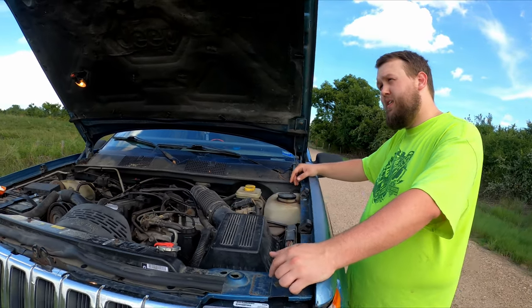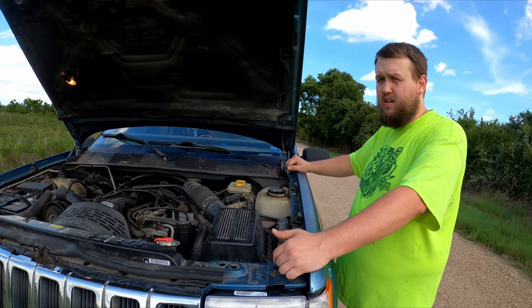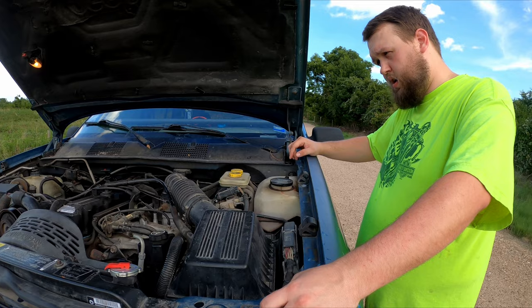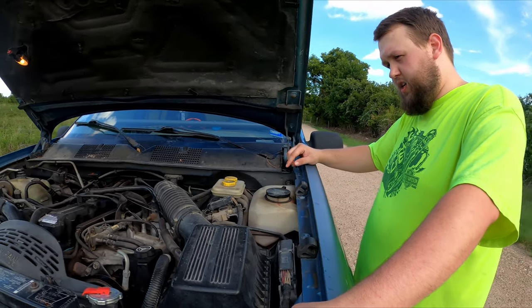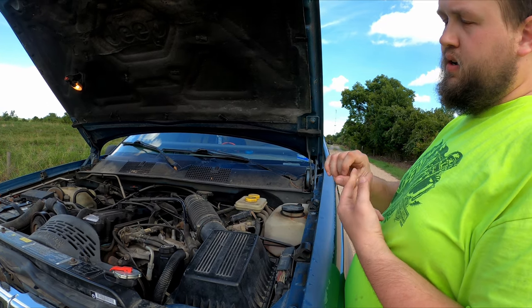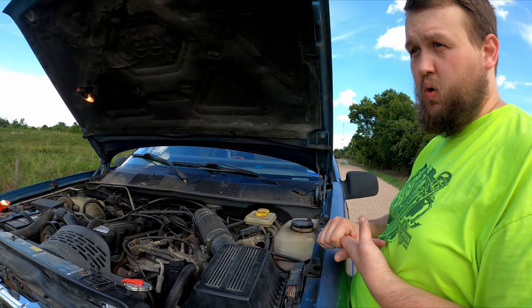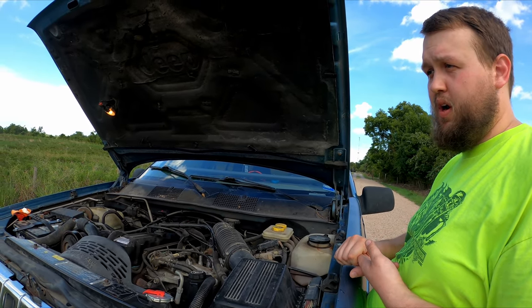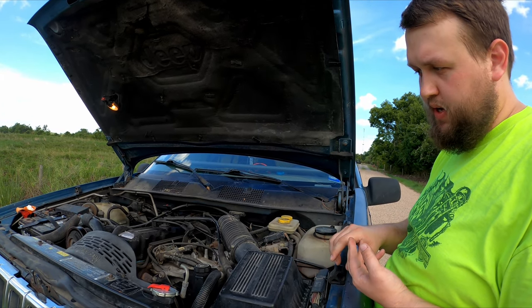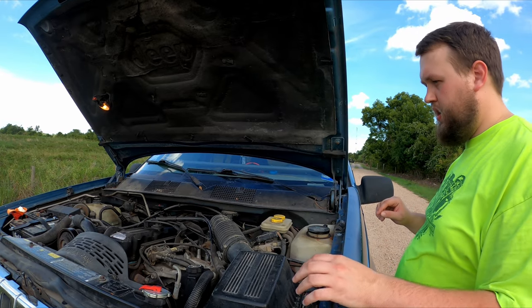And then the issue that plagues all 4-liter Jeeps, cooling. This one in specific, I've got a new fan clutch. I put a new 180 thermostat in it. I'm in South Texas, so it doesn't really get cold here. If you're up north, you're going to want to stay with the factory temp so that everything can get into closed loop and you have heat in the wintertime like you're supposed to.